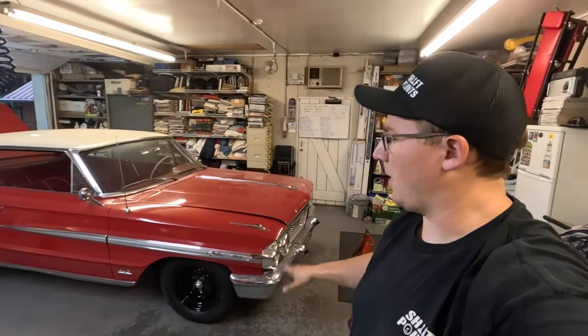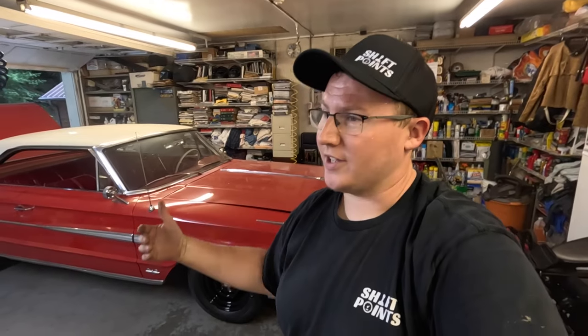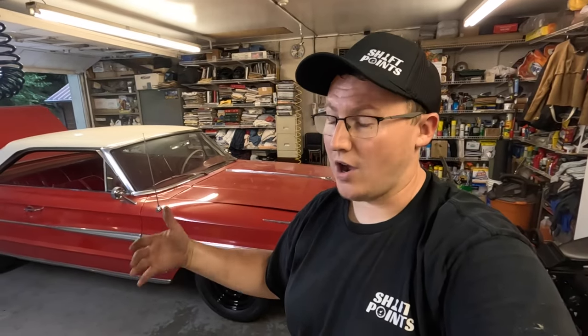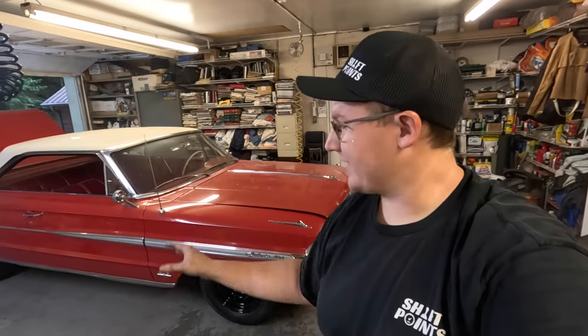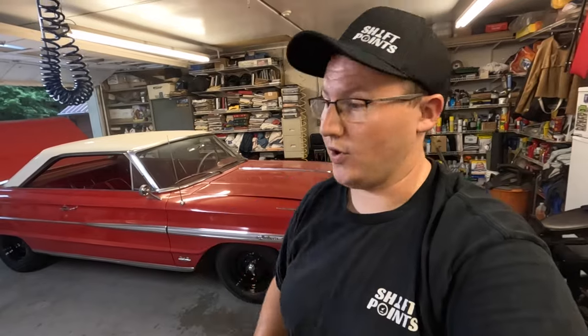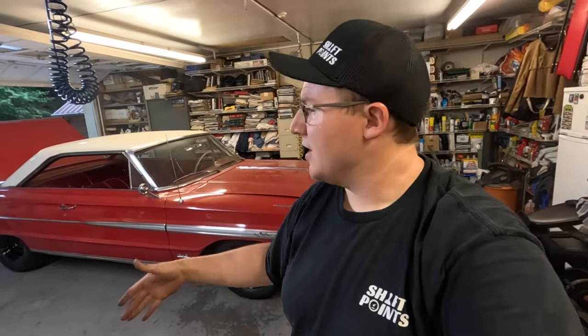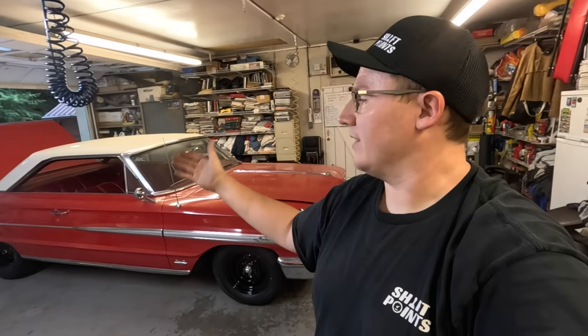We'll do that. That'll probably be one of the last things we do. We actually had to take the jack stands off the axle housing, move them to the frame, and let the axle housing sag so that we could get that wider rear tire in there. It just barely fit as far as getting it in. There's plenty of clearance on the width once it's in place, but getting it between the axles and the fender was tight.